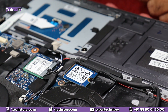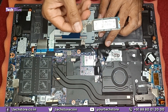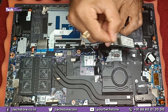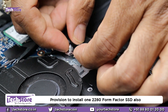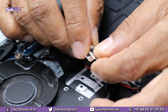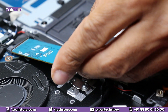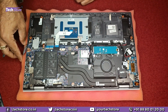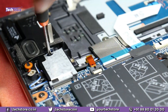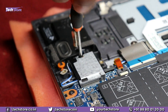You can install 256 GB, 512 GB, or 1 TB drives on either slot. Importantly, if you have a 2280 form factor (the longer M.2 SSD), that can also be installed in one of the bays. By removing a sticker and repositioning the notch screw, you can configure that bay for the 2280 form factor. So you can put the short 2230 SSD in one bay and the long 2280 in the other — a very thoughtful design.